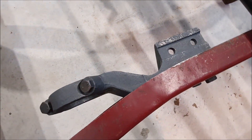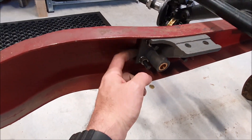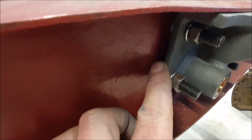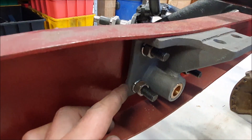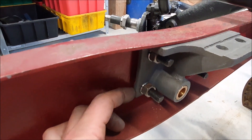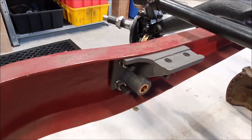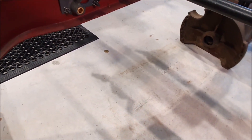So the bosses in behind here aren't really sitting hard up against the chassis rail like they should. Before, I just put little washers in there to space them out — you can see there's a washer in there and a washer at the top. That works fine, it's not too bad a problem. But the washers are flat and because of the curve on the chassis they really need to be tapered, so I decided to make little tapered washers for them.